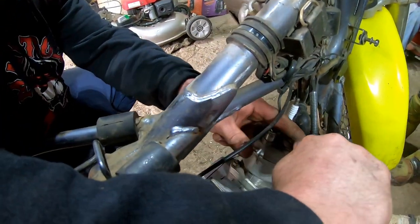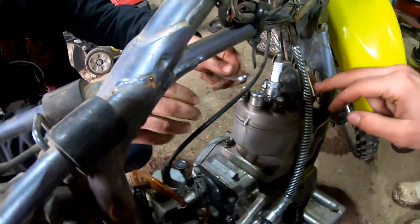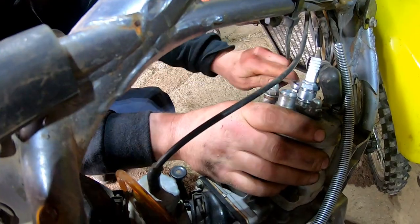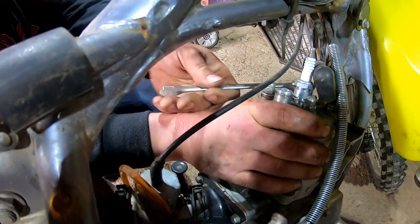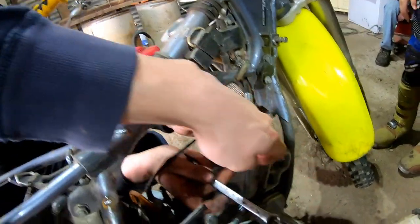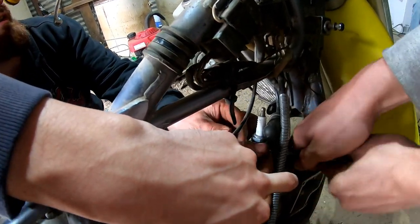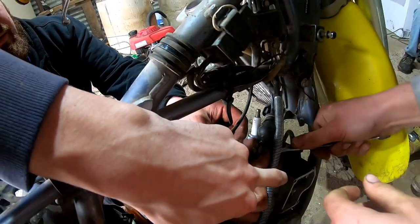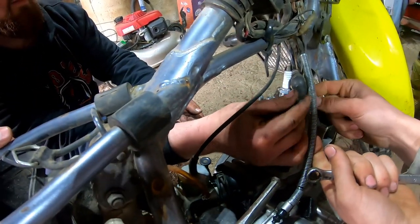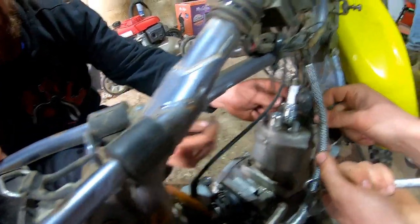And what size is that — 12? Twelve. And there are gonna be copper washers on all four of these. What a copper washer does is it just seals up — it's a little softer, so it keeps everything in: coolant, heat, fuel, combustion. They're tight, but they're nice with acorn nuts. You don't get dirt on the end of the threads, and they can't oxidize like an open bolt. They did try a new spark plug — I can tell it's brand new. We pulled the plug initially when they got it and it looked brand new. Still didn't turn over.